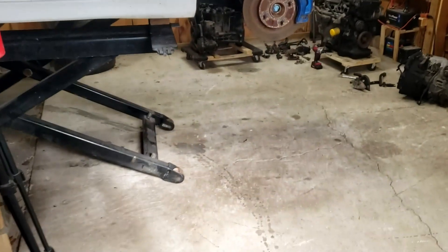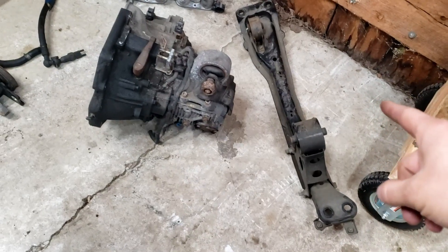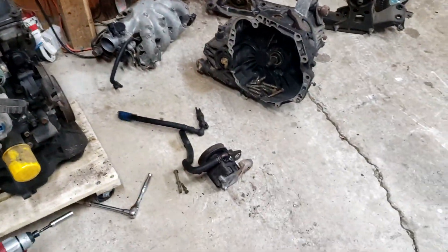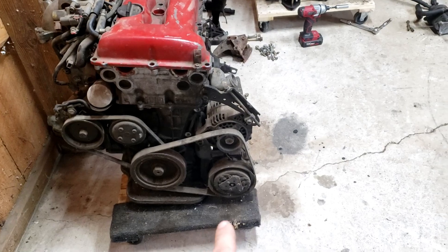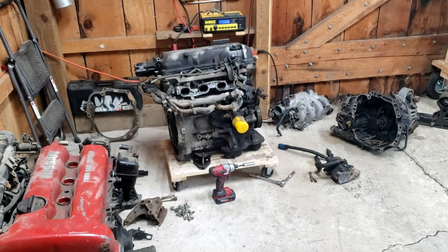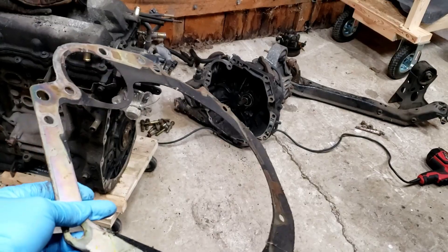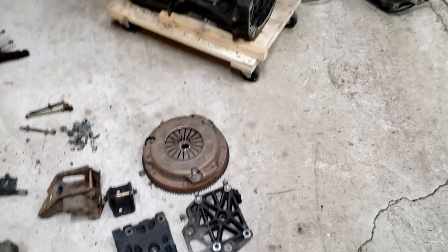Now that the spec is up in the air, I got everything out of the closet. This is the Spec V stock crossmember from the QR. I kept the motor mounts — hopefully they will work with this stock five-speed transmission for the SR20. That's stage one of the swap. Intake, power steering pump and sorted brackets. There's my spare motor; this motor has the AC pump and the alternator that I need because they were roached on that motor. The AC pump is actually rusted and seized. I'm about ready to put the clutch and flywheel on the back of the SR and mate the transmission up with it. Remember: put the plate on before the flywheel. I can't tell you how many times I've had to take a transmission and clutch and flywheel off to put this on.